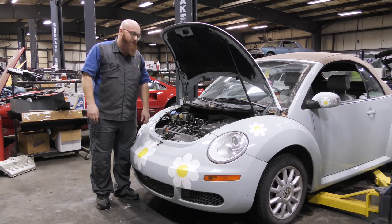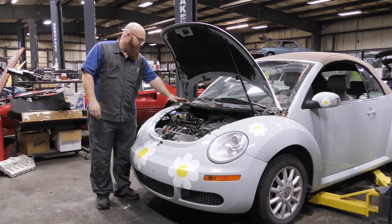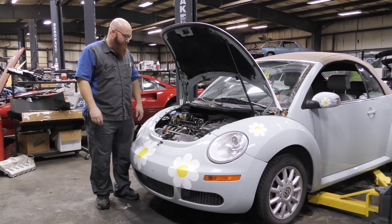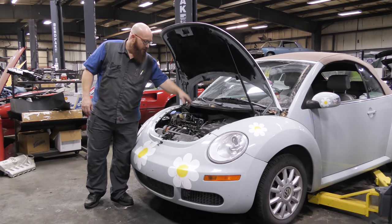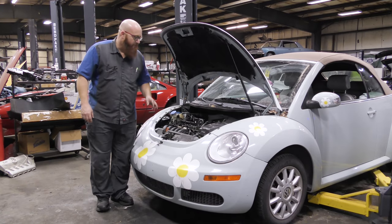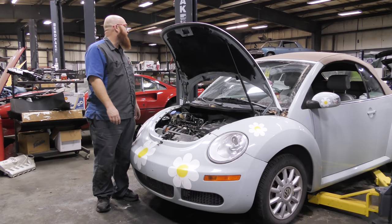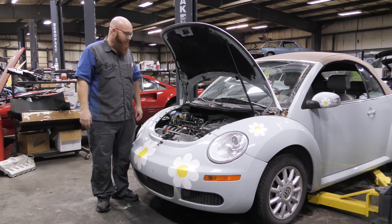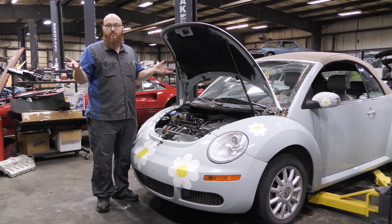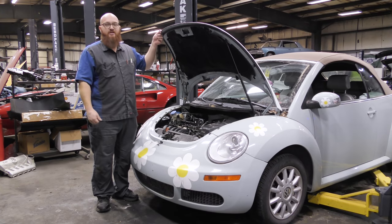There was no sense fixing one or the other — two birds with one stone. So to recap: MAP sensor fixed the code, airflow sensor just needed to be plugged in, new valve cover with new diaphragm, and we also took care of the leak detection pump — got a new pump in there. Everything is taken care of, the code went away, it's working and functioning properly. Let's go ahead and take a look under this car. It's not a museum piece, but for what it's meant for, it does good. Let's get this thing in the air.